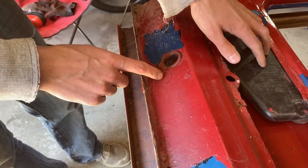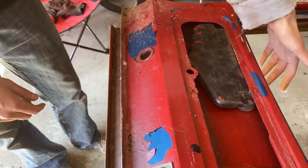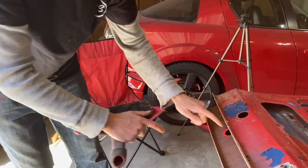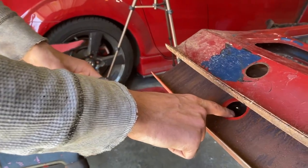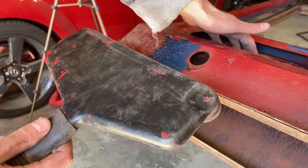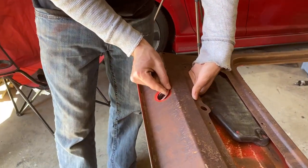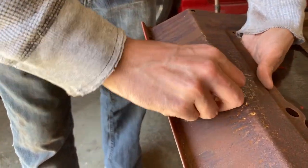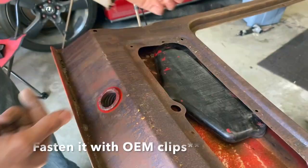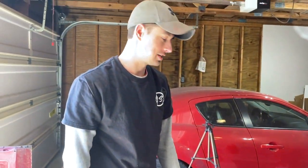And the purpose of these, from my understanding, is to get the exhaust fumes out of the cabin, if you have any, or keep it away from the cabin, and it vents out to the atmosphere. When I was looking at the 280Z without the vents, they still have the holes. These holes lined up. They just had grommets in them. So once I popped this out, I found out that this will line up exactly, as long as I get this right where I want to put these vent holes. The hole and everything's even the same size down here, so this will line up with the lip just like that. They line up perfectly, so as long as I get these holes in the right spot, I could screw this down from the other side, and then I'll have my 240Z Series 1 conversion all done.